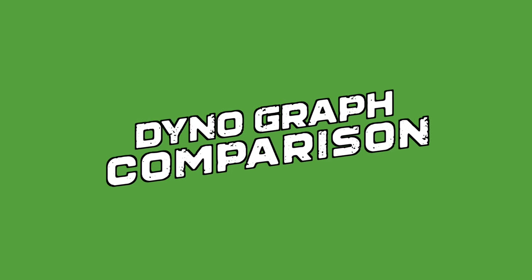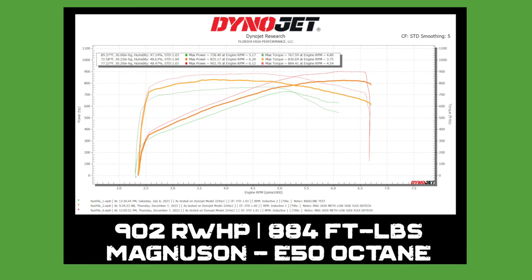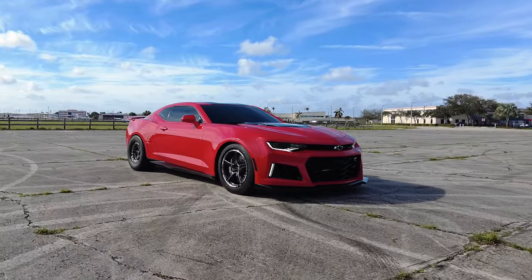I'm going to put a graph up and you're going to see a couple of things. You're going to see his baseline results when we tested this vehicle as-is — it was under 750, I think it was 724 rear wheel horsepower, just over 700 foot-pounds of torque. Very weak numbers for the combination he had. Then you'll see after we were done with it on E50, we actually made over 900 wheel — 902 wheel horsepower and about 886 foot-pounds of torque. We put our tried-and-true package together, parts we know work. Everything is results-based. We don't just take guesses; we're not just hoping things work. We went to the drawing board, we got the car right, and the results speak for themselves.